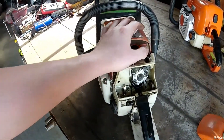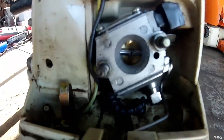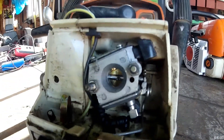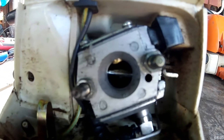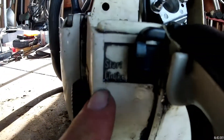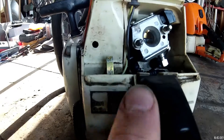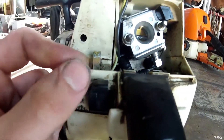I found out after doing a little bit of work inside of this thing — check out what's inside this carburetor. You have your throttle down here on your trigger, and that goes into this throttle body and you can see it opening and closing there in the back. Also note what it says right here on this switch: there's the start position, there's the run position, there's the off position.